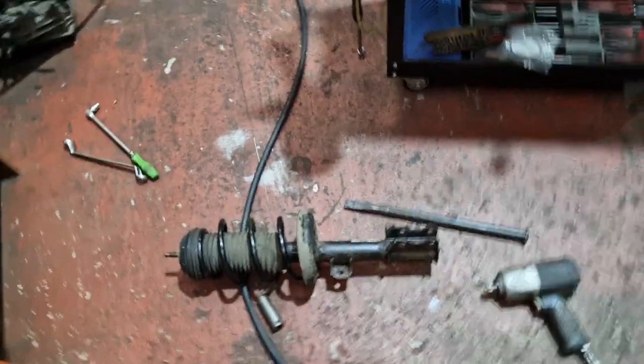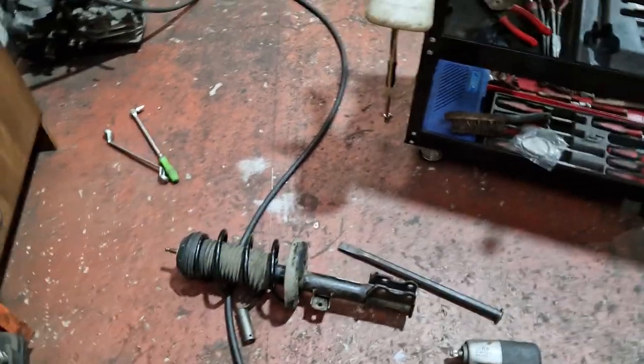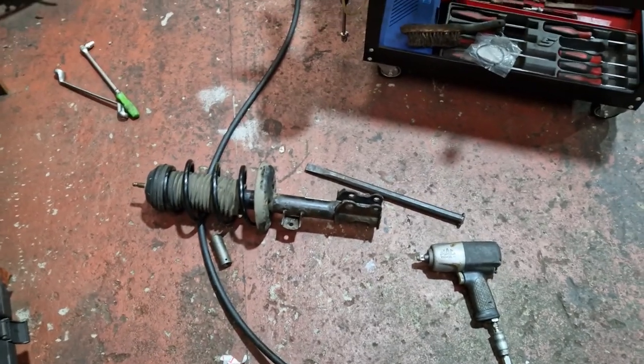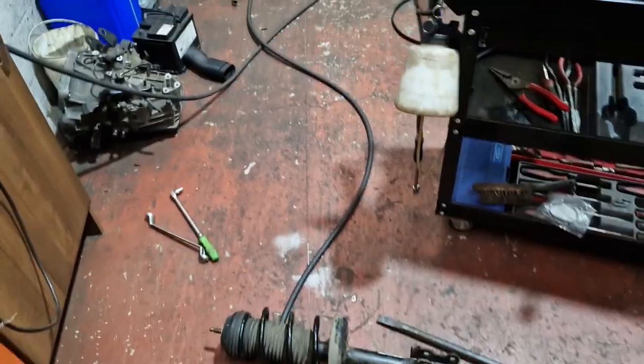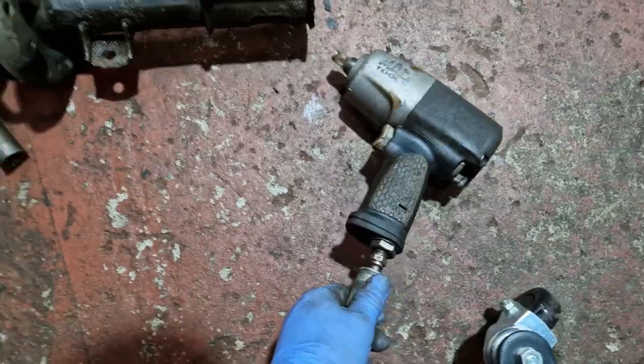We've already put the oil and filter in it, we'll just get the air filter to change after we've fitted this. Obviously we'd run it up to temp yesterday, left it running for quite a while, maybe about an hour, plus we're really, really working the engine. Loading it up, revving it up, making it work, trying to get it hot. Not trying to overheat it, but trying to make sure it doesn't overheat. And the fan seemed to be clicking on and off, on and off, so that was good. So I haven't even had to walk down the shop, you know.